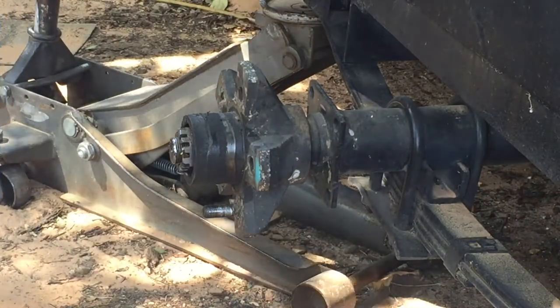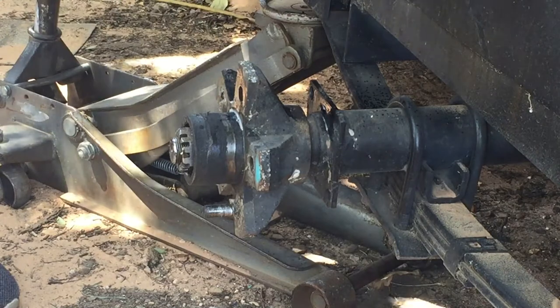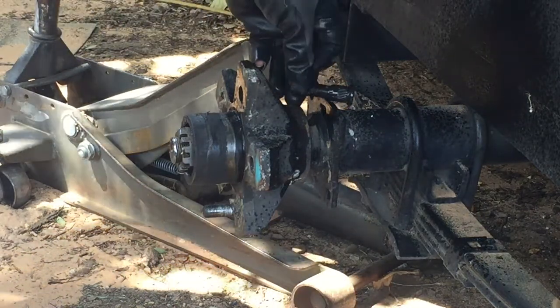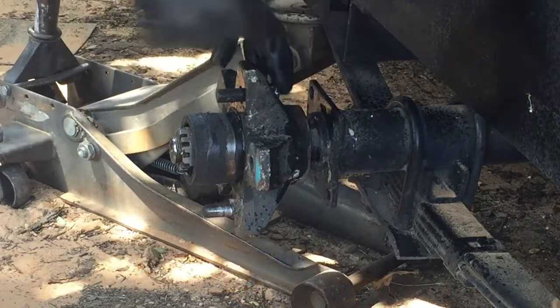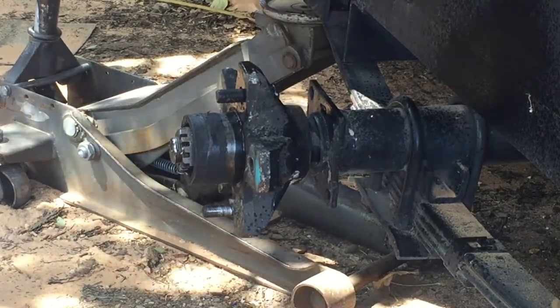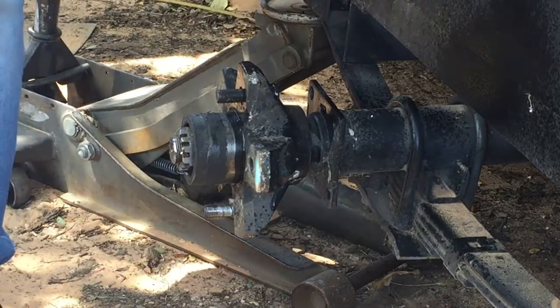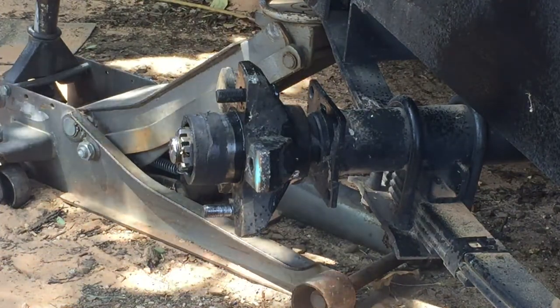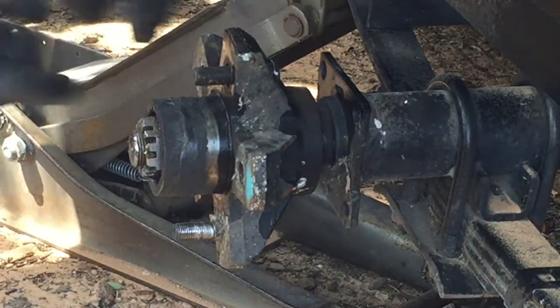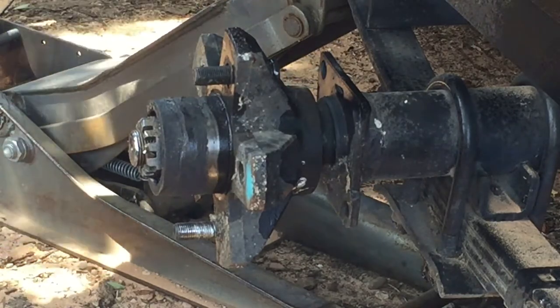What I'm going to do is take some penetrating oil and spray it in there, spray these little grooves on the stud itself. If you have room on some vehicles — or even a trailer — you can hit it with a hammer from the back. If you do, that's awesome. But if you don't, like on this trailer, just stick it in there like that. I bought a couple extra studs to use to drive it through, because sometimes you'll damage them. There is a special tool that goes in here and when you spin it, it drives the stud in — it's got bearings in there — but I don't have that tool, which I'm probably going to invest in since I do a lot of this.